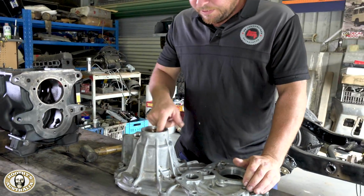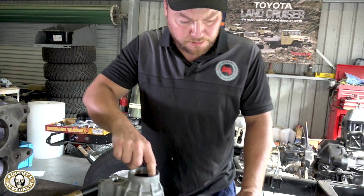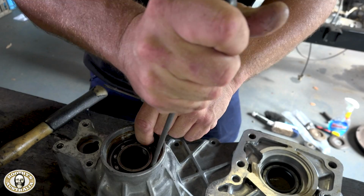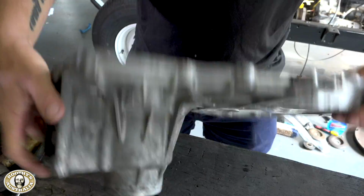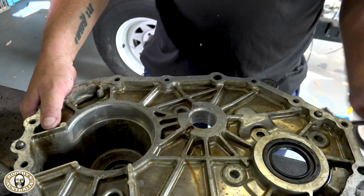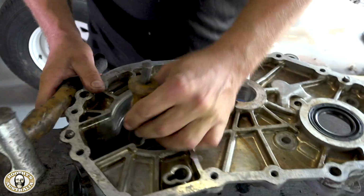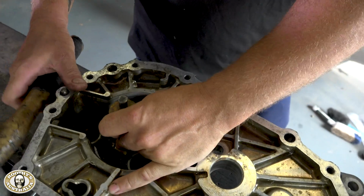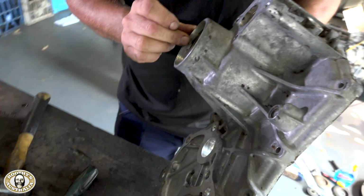Now I'm going to remove this bearing out of here. It's quite noisy actually, so we're going to pop this out. Is that the little C-clip or something? Yeah, get the little C-clip out before we knock it out from the other side and replace it with a new bearing. Oh, okay, so that's the bearing in there. Yeah, we'll just use a drift. Probably should be using a longer drift than I'm using, to be honest. Yeah, you're playing it fairly close to the case there. Definitely, mate. A few scars on my knuckles from previous attempts. Well, at least you know what you're doing, mate.